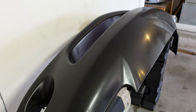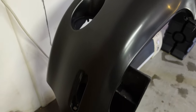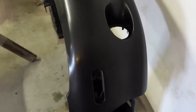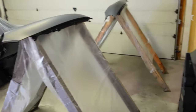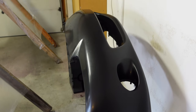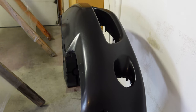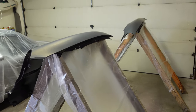If I need to redo this in the future I won't feel too bad about it, because it'll look good enough for what it is — it's a project car still, despite being probably the most put-together car that I have. I'm going to hit those with some IPA and see if I can get those spots off. I think we'll probably do the bumper first. The adhesion promoter — you have to spray it and then immediately color it. If the adhesion promoter dries, it kind of re-hardens that top layer of plastic. So I think we might do the bumper first and then move to the fenders. Let's go ahead and jump into it.